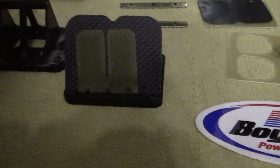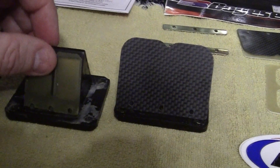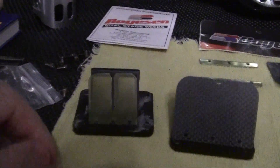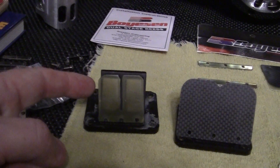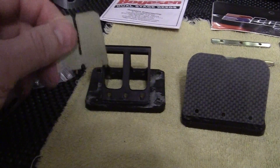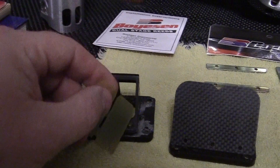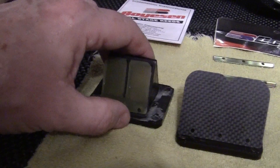I had to make it fit on this cage, as you can see. The trick is — and this would be a good learning lesson — you can see where the reed is off center, it's not sitting right. The reed must cover and seal everything: from this little area here, to up here, to along the edge, to along the bottom. It has to seal it correctly.